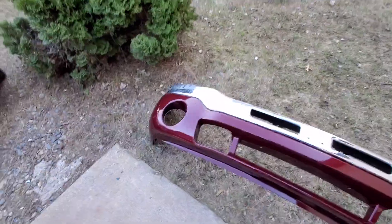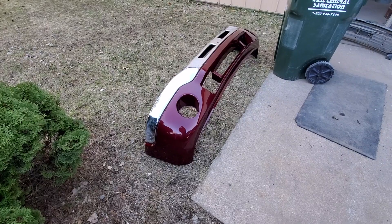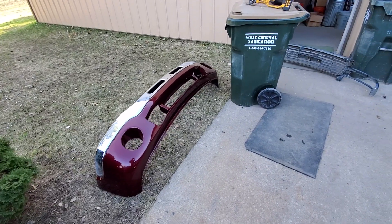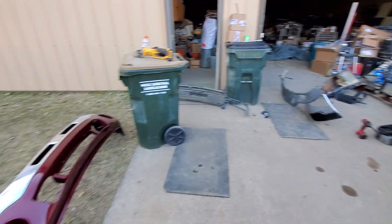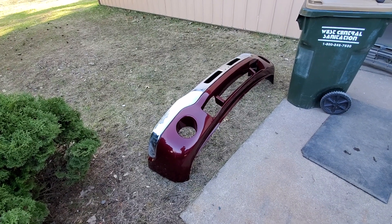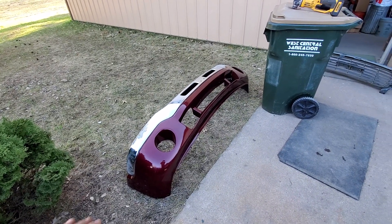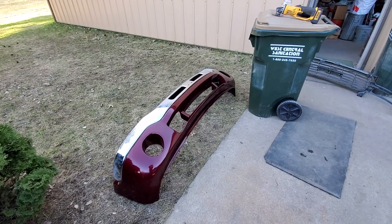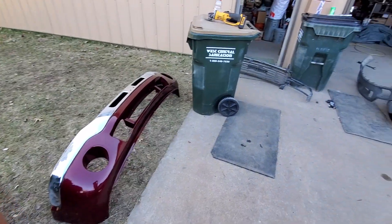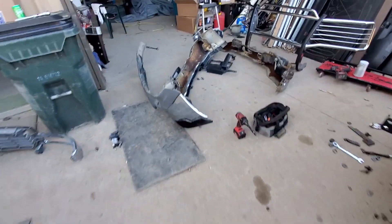So it was pretty expensive for this bumper cover, but it does look good. This bumper cover is finally secured to the bumper bar. On the 06 I found out he had like none of the darts - there was maybe five or six. There are 17 total on this bumper and he had five or six. That's why the bumper was always rattly and squeaked - plastic darts in their little clips.